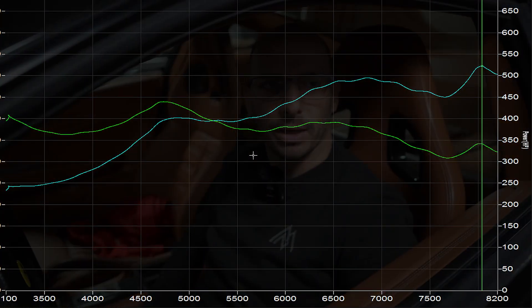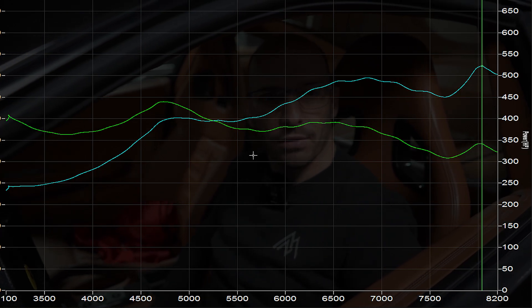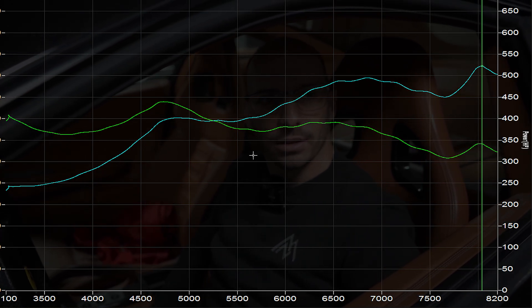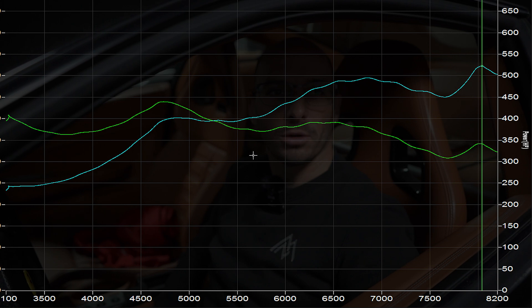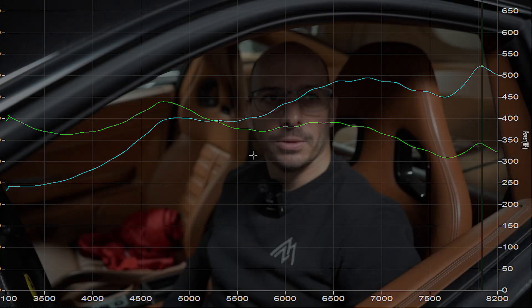The graph is very lumpy — three big humps at 4,700, 6,500, and 8,000 RPM. Hopefully when we tune it with a MoTeC we'll be able to smooth some of that out and recover some of the power in those dips. With a freer flowing exhaust, hopefully we can also find some more power. It's not overly impressive, but it's consistent and the engine sounds healthy, so that's good.